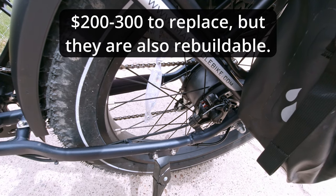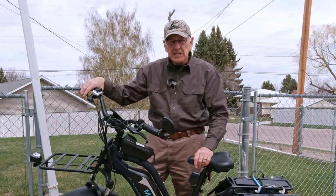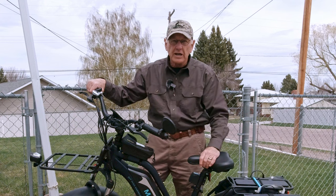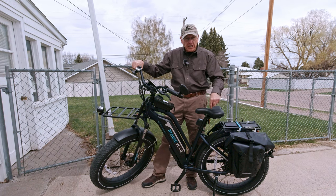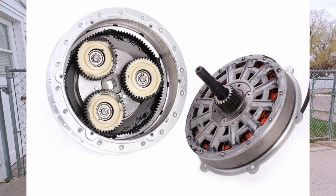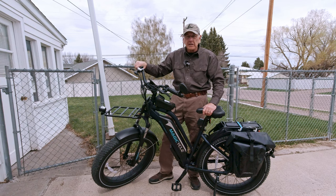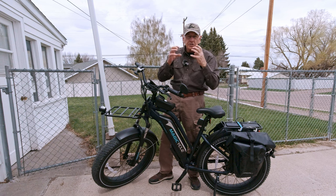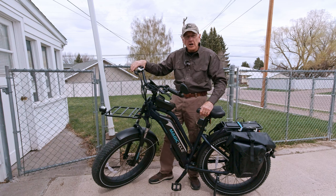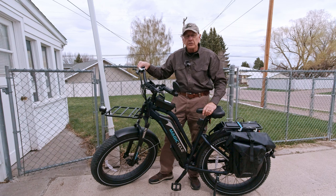The only other thing is the hub motor in the back — a 750-watt hub motor, generally running a couple hundred dollars. That is the one thing that can and will go out. Whether it goes out depends entirely on how you treat the bike. For example, if you're going up a really steep, long hill depending on just throttle, you can burn that motor up by overheating. You need to use pedal assist going up hills and help that motor out. These are geared hub drive motors, and those gears can strip if you're constantly using only throttle to get started from a stop — it puts pressure on the gears and causes them to slip and wear out. Always give it a little pedal assist or a small push with your leg to get some forward motion before coming in with throttle.